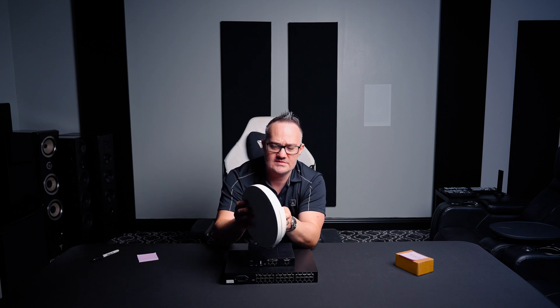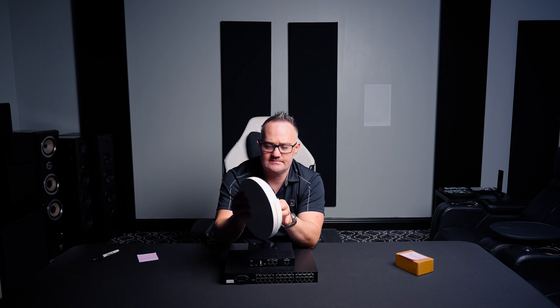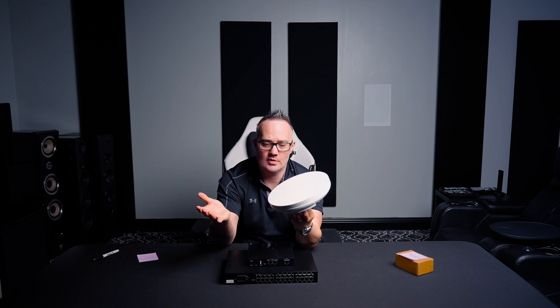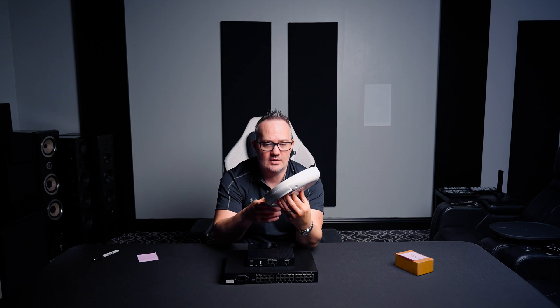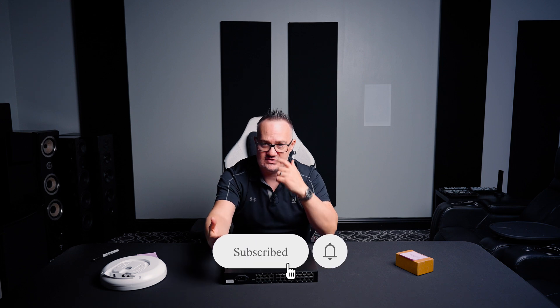These wireless access points — WAPs — should be about 75 feet apart for best home coverage. You don't want them too close to one another. I have four in my house just because it's weirdly spread out. We only have one right outside our showroom door and it works great. So a properly set up commercial-grade network goes: modem to router, router to switch, everything wired into the switch with the router assigning addresses, and WAPs throughout for WiFi.